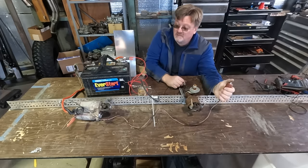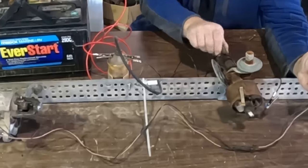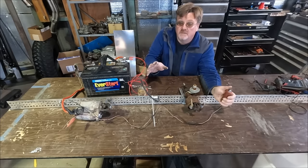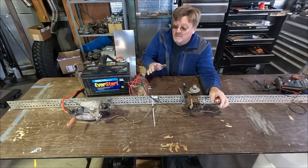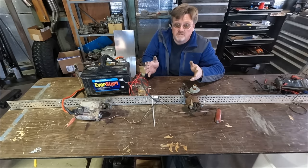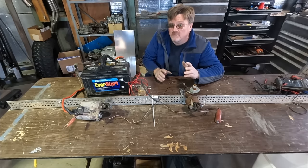We've got spark — it'll run with this and you can drive it around. This very truck drove away the first time like this. As far as the engine is concerned, this is fine — it's getting electricity where it wants and that's all it cares about. But for your own convenience, you're probably going to want to start adding switches, because that makes life a lot easier.